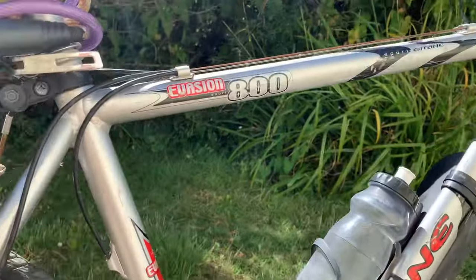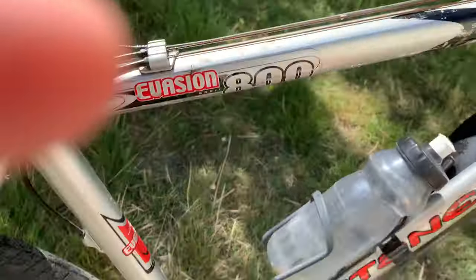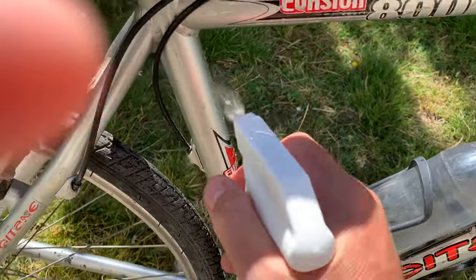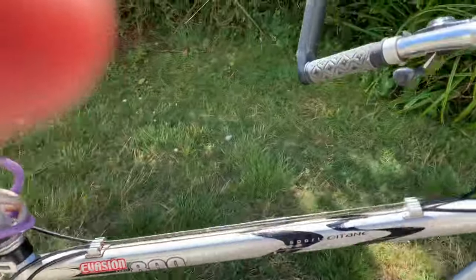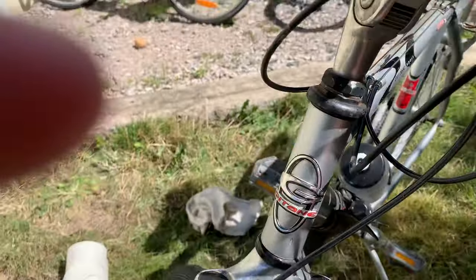I'll do the rest of the chain and then on the frame you can see these cables are not good, so I'm going to spray on the top here like so. I'm basically going to spray the whole frame and then use the mutton cloth to wipe over it. Just mind the brake blocks — or masking them up is probably a better idea.